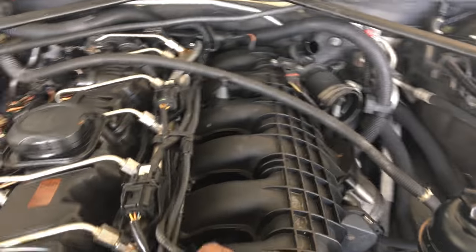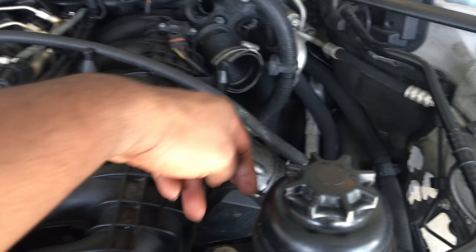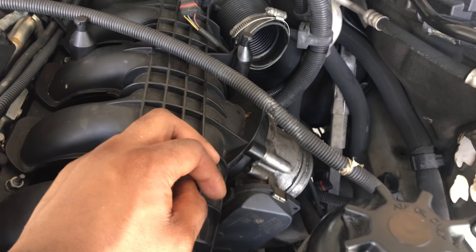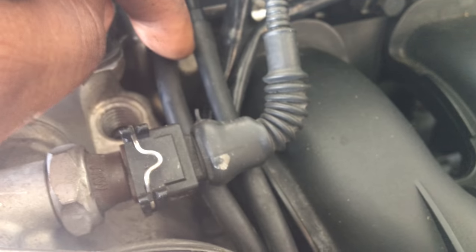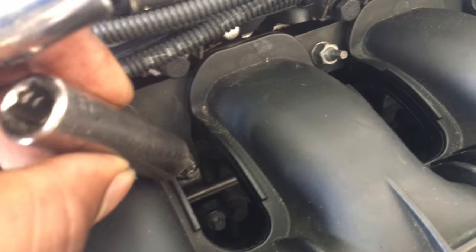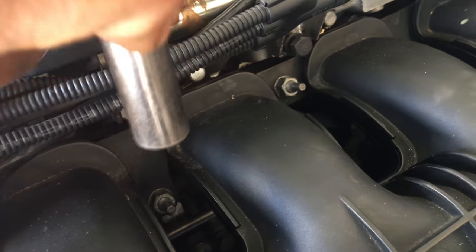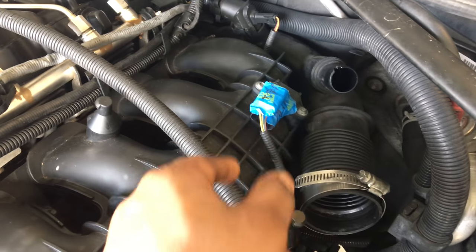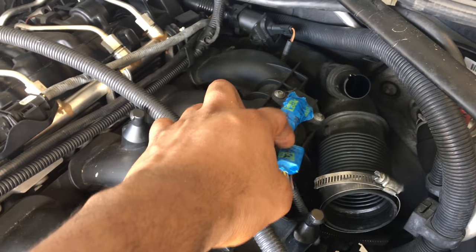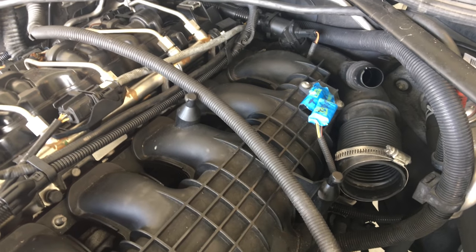What I'm going to do now is start taking off the intake manifold. Once I get down into the depths of this, I can disconnect the final few things and then take the mounts off. I'm going to use a number 11 socket right here to take off that bolt, and then a longer number 12 on the rest of these bolts right here — they crisscross all the way to the end, so one's up top and then it alternates, one at the bottom. All the bolts are out now, and I went ahead and labeled these connections to make sure that next time I'm ready to put these back together I remember exactly where they go — just in case my brain farts.